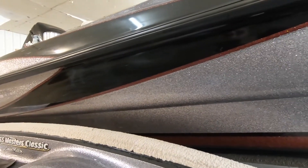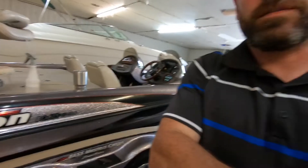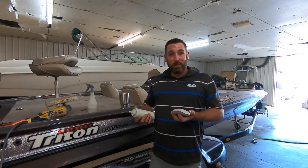So what we also did is we sanded off all the wax. We want to seal that area back in since we basically took a millionth of a millimeter of gel coat off that spot. This is the part where you can finish the area you've just wet sanded — either by hand or with a high speed buffer.